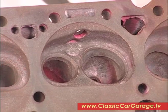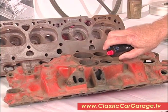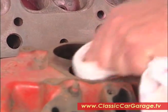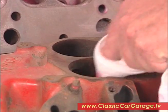Now on this intake manifold I know there's a crack right here. Let me show you how we're going to go about detecting it. I'm going to shoot on this cleaner and clean it all up, making sure there's just no dirt or grease in there because that could invalidate our test.